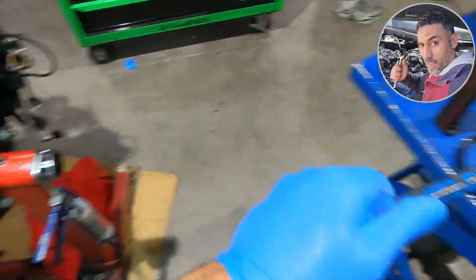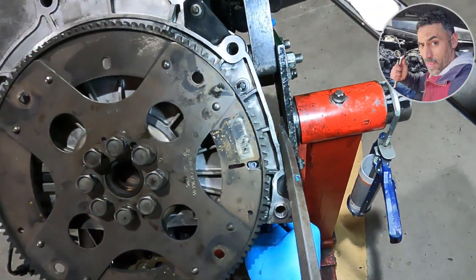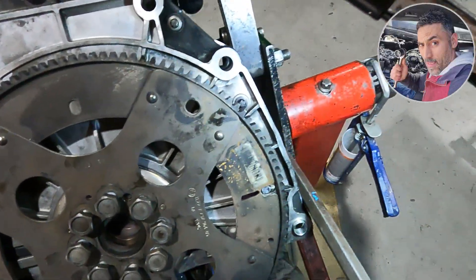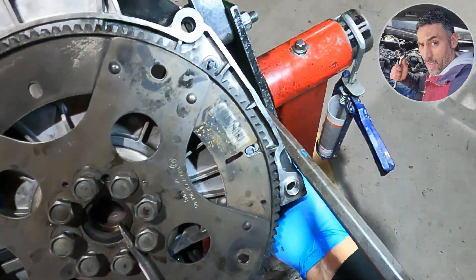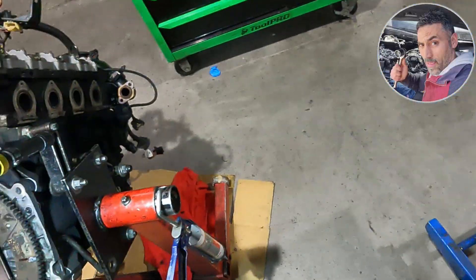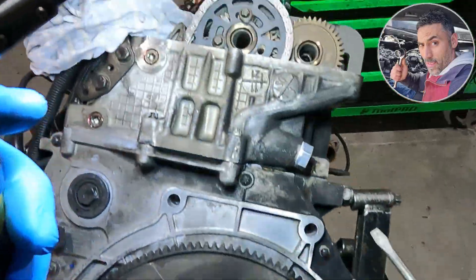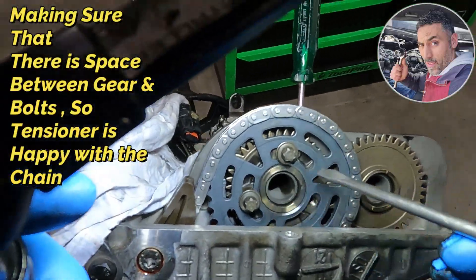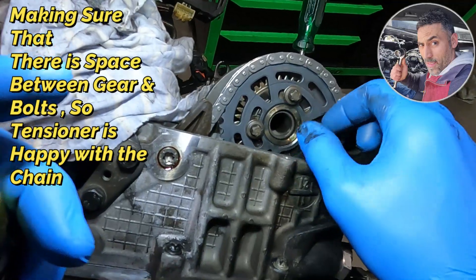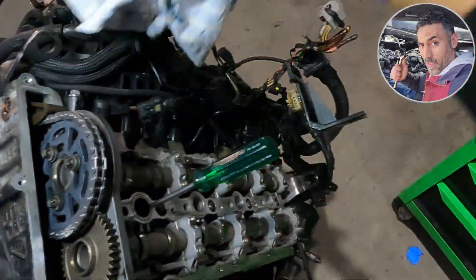Now it's time to lock the timing. I put the pin on the flywheel and push the engine a little bit. I put the pin on the flywheel long hole — see, I put the black mark. Now I turn this way. You remember from part one when I set the timing for the oil pump — now when putting the spin, the timing on the oil pump changed a little bit the other way. Now making sure the bolt and the gear don't touch, because if they touch it means the tensioner didn't take up enough slack from the chain. Now they're not touching — that's all good.